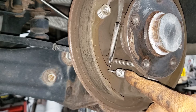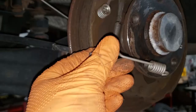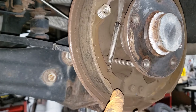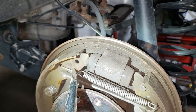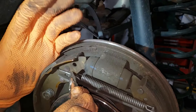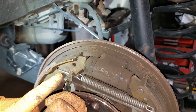Get your vice grip, clamp it as tight as you can, and then pull the spring out like so. Don't just throw the spring anywhere — get a table and lay it out exactly as it came off the vehicle, so you have a diagram, or take a picture or make a video. Now we're going to get the top spring off. Because your wheel cylinder is here, be aware of where your shoes are when yanking the spring off. Place your hand there, grab the vice grip, and yank. The hook for the spring goes through this hole, so your goal is to pull the spring far enough to pull it back toward you. Let the blood come back into your head, then place the spring on the table the way it came out.